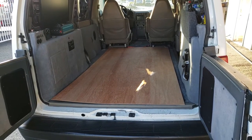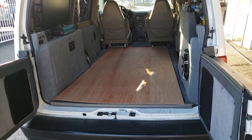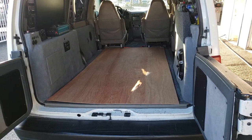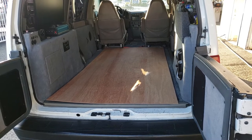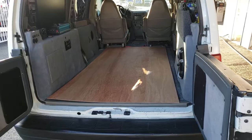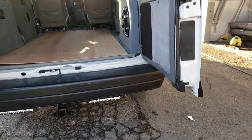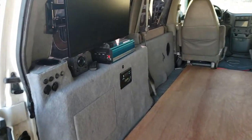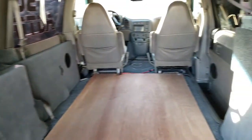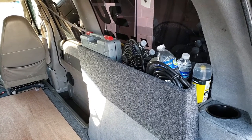Primarily it has to be a useful work vehicle for our business, and that means throwing a bunch of speakers, amps, tools, etc. in the back and taking it down to an off-site job or a yacht. It also needs to still park in a normal parking spot. We also build a lot of custom boxes, so being able to haul four-by-eight sheets of MDF or anything else is very useful. It has air fittings, LED lights front and rear for working, a thousand-watt true sine wave inverter for powering tools and charging battery packs, a little tool pouch, and a fan and water so we always have the bare minimum with us.